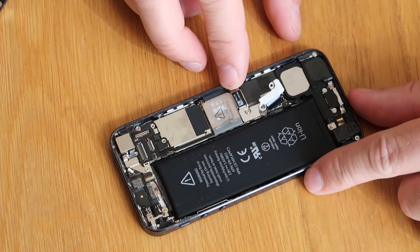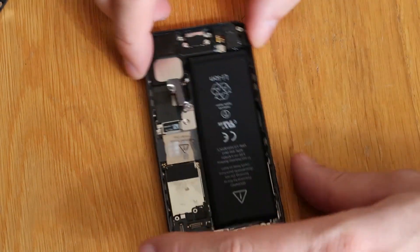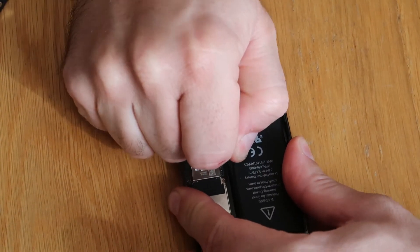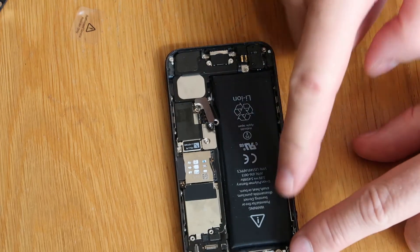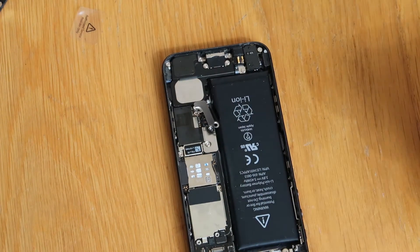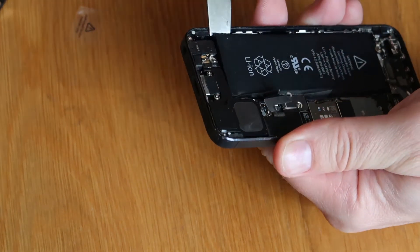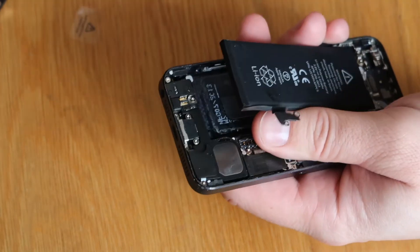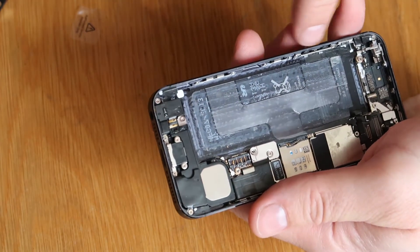So what we'll do now is the battery. Apple have made it so you can pull this tab and your battery will lift out. I rarely get this to work — as you can see, the tab always comes off. I end up usually having to pry these up. One thing I will say is just around here there's a little flex cable, so you need to be quite gentle. I tend to grab a spudger — a metal or plastic one — find a point to pry just very carefully and it will come. Just be really gentle when you get to the top bit up here, because there's your flex running there which runs your volume buttons.